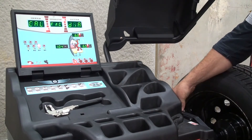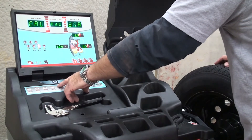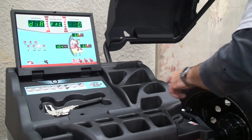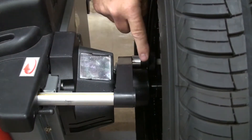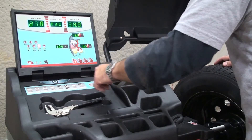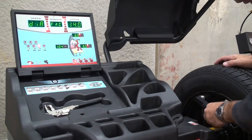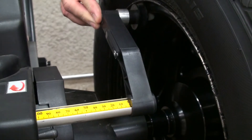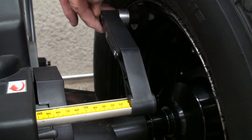When we release the arm it will go into the diameter calibration. Press the home key, and with the arm located at the stub of the shaft, press the home key. Next we'll bring the arm to the bead seat on the rim — in this case we have a 15-inch wheel we're using for calibration.